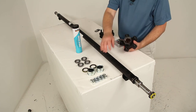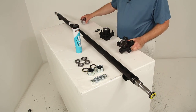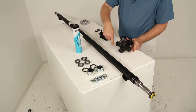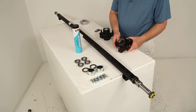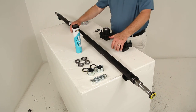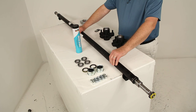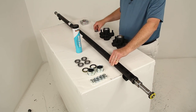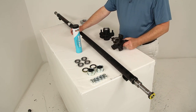The studs are half-inch diameter, so they use the half-inch lug nuts that are included. The flange diameter of these hubs — basically the diameter of a circle drawn around the whole hub — is about 5-1/2 inches. Because of that, it will accept wheel sizes from 8 inches to 12 inches in diameter. That should do it for the review on part number 20545I-EZ-72-10, the Dexter trailer axle with the straight easy lube spindles and the 5 on 4-1/2 inch idler hubs.